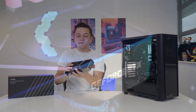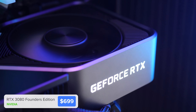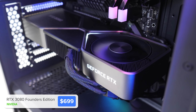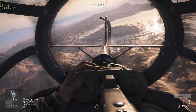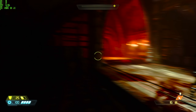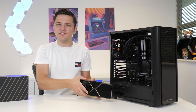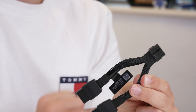It's now time to install the graphics card — NVIDIA's brand new RTX 3080. With 10GB of GDDR6X memory, NVIDIA's latest axial flow cooling design, and basically twice the performance over last generation, this thing is an absolute beast. It also features NVIDIA's new 12-pin GPU power connector, which delivers plenty of power in a really small form factor. NVIDIA includes an adapter for this cable, which shows just how compact that new 12-pin standard is.